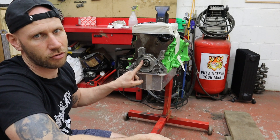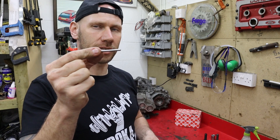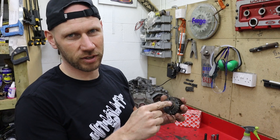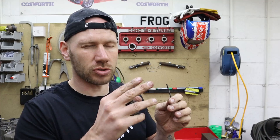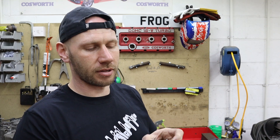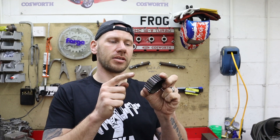All that means is I drill through the pulley into the crank and then install these little 4mm dowel pins. Some people use 4mm, some use 5mm — I use 4mm to good effect; they seem to fit the nose of the crank area okay. But they have to be fitted really precisely. You drill them undersize and then open them up with a 4mm reamer bit. I drill to 3mm then 3.7mm — just under — then ream the holes out to exactly 4mm so the dowel pin is nice and tight. Because if there's any movement on that dowel pin, you effectively haven't fixed the problem. So it's got to be precise. We'll start by drilling the crank pulley itself.